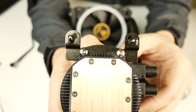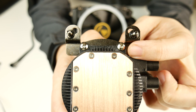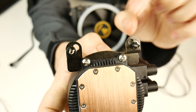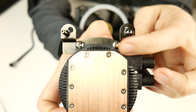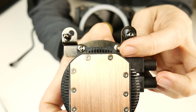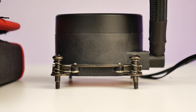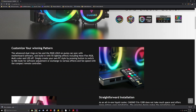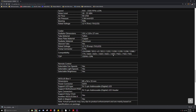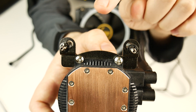I've brought it in even closer so you can see this. See how I have these mounting screws on the underside of the heat sink with this bracket on the front side — this is actually the correct way to mount your mounting hardware to the pump block. If you don't mount it like this, the heat sink will be sitting too high off of your processor and you may experience some really bad temperatures as a result. The directions do specify how to mount this, and while they're not printed in the box, you can easily download them at the bottom of the product splash page. Read the manual.